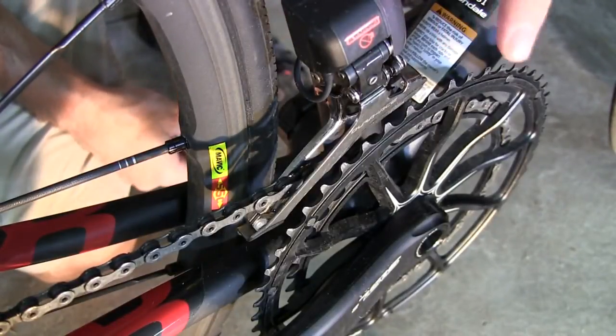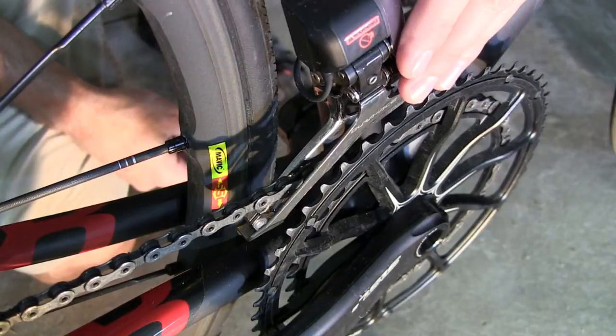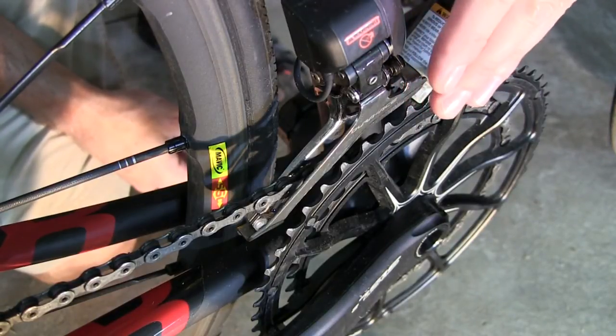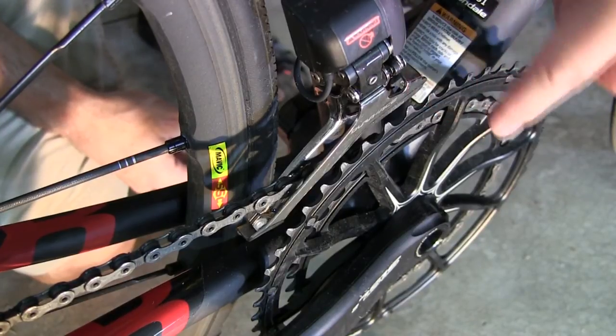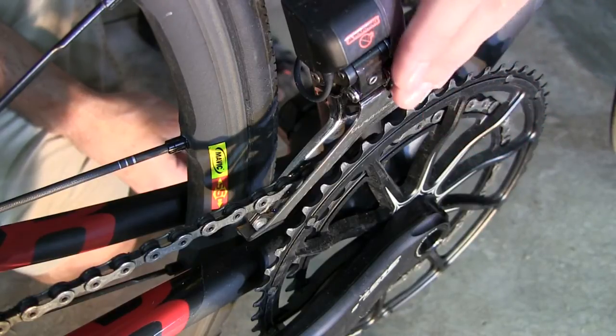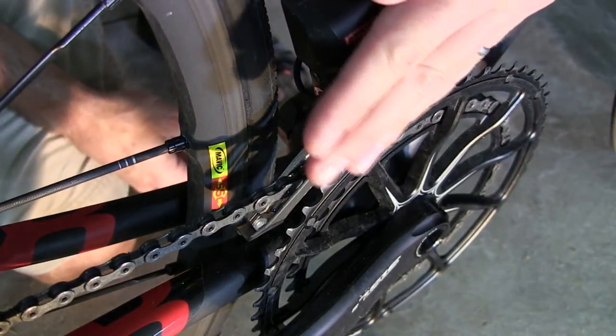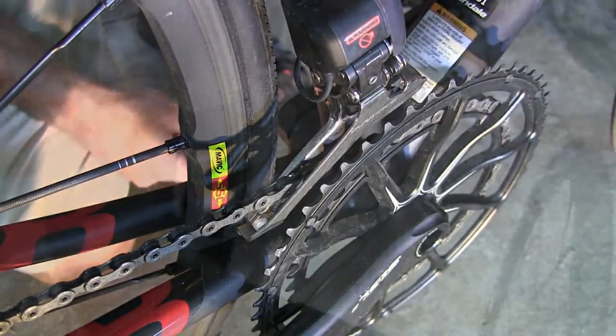And you'll note that little, as I said, that little operation when it goes up, comes back. And that was also one of my concerns. It obviously helps it get up to the chainring and then come back. But it's that little extra push over, which I think was also partly to blame for my chain being thrown off. But nonetheless, the actual derailleur has been toed in a bit more to prevent that. And now it seems to be working 100%.